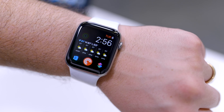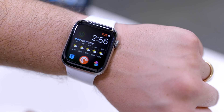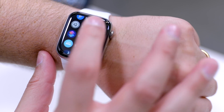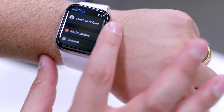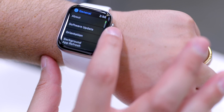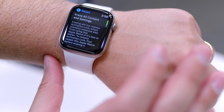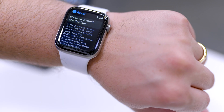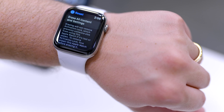You can tell your iPhone to stop the cellular plan, but you may also need to contact your cellular provider to make sure that line is canceled, as sometimes the line doesn't get canceled without you actually calling your provider. If you unpair the watch successfully from the iPhone, you shouldn't have to wipe the watch additionally, but you can also do that by going to the Apple Watch settings, scrolling down to General, then to Reset, and selecting Erase All Content and Settings. But remember, don't do that until you unpair the Apple Watch from your iPhone.